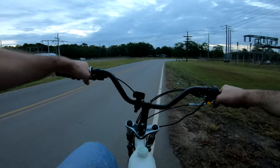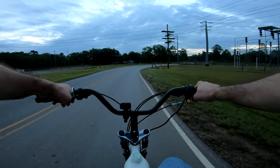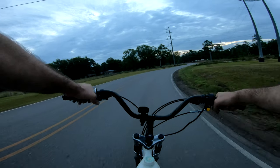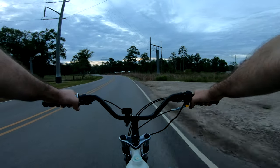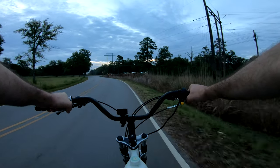The first issue I ran into was the clutch. It was slipping quite severely, which was odd because, as far as I could tell, he had it adjusted perfectly and there was plenty of spring tension. And this I won't blame him for, because his motor fell victim to a very rare issue which I've only seen happen once. And this would be easy to miss even for me.